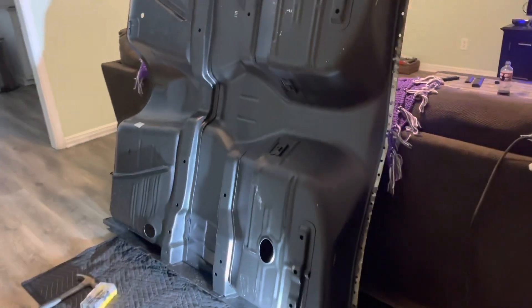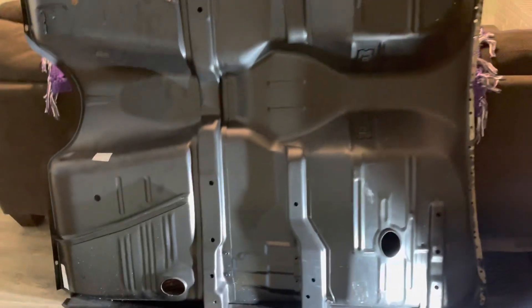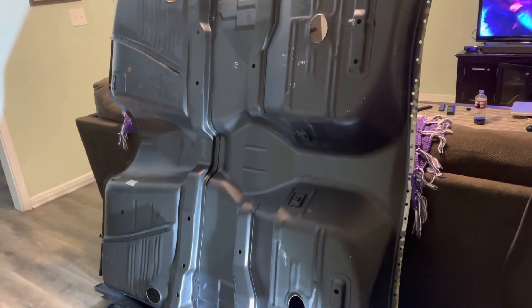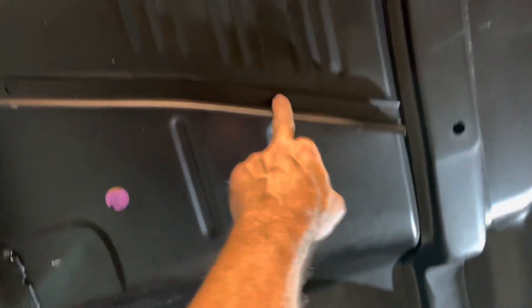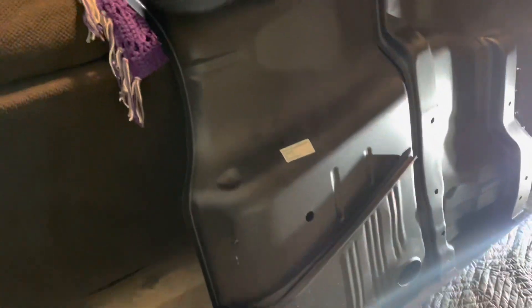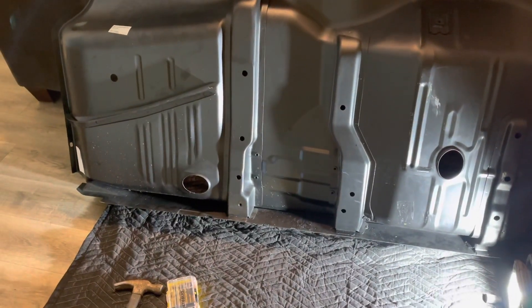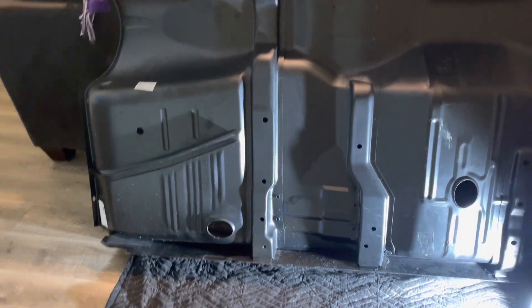So this is more of the floor, just kind of a how-to. This one-piece floor — let me count the pieces. It comes with a rear seat pan, a total front seat pan. It comes with five braces — sometimes these rot out. It does come with these two L-braces that go up towards the firewall. The floor pan plugs are oval and not the rounder shape, so you can kind of tell that's a repop.